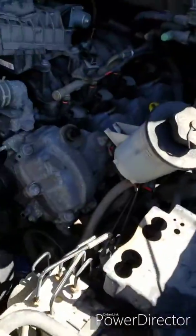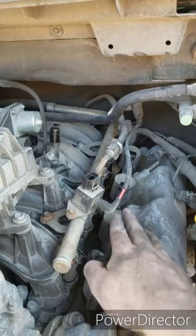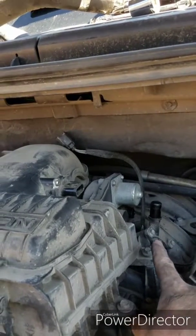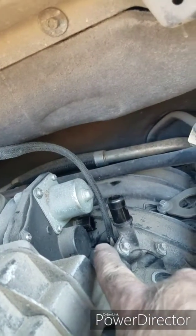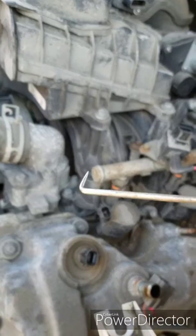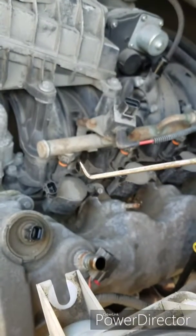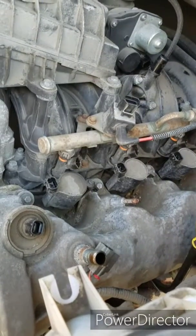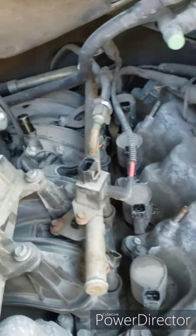We've got our wiring harness off. Just disconnect all these clips - some you have to pull out. On the one towards the back on the throttle body, it's way back there and a little tricky. You do have to use a 90 degree pick - pull out the tab, it's bright red, you can't miss it. Pull that out and then use the bend of the pick to press up and release the tab, and it'll come right off.